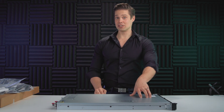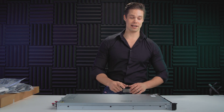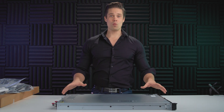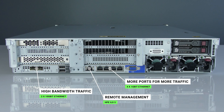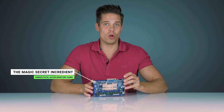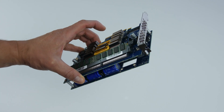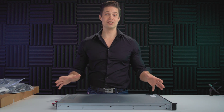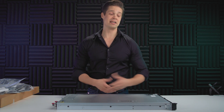Why I'm so excited about this specific version of SimpliVity is two things, basically — or three things. It comes in one rack unit form factor, so it's tiny. The form factor is actually ideal for many use cases these days. The second one is that it doesn't actually have the physical Omnistack accelerator card anymore. If you remember when I did a review or hardware tour of SimpliVity 380, the 380 had — and still has today — the separate accelerator card, which is responsible for secondary data operations. They are claiming that this software version of that same physical card is actually not that much behind what comes to performance. Obviously, it is eating a little bit more of the main CPU and memory capacity, but that's the trade-off.